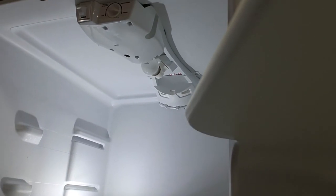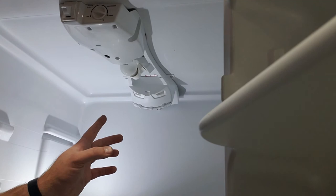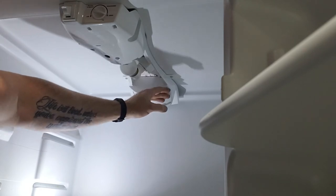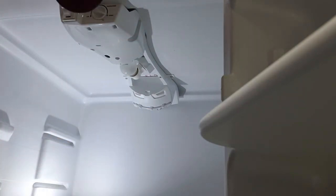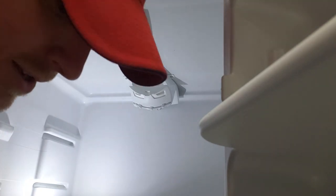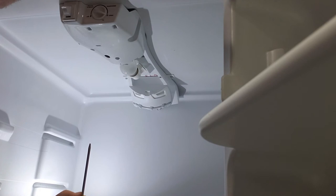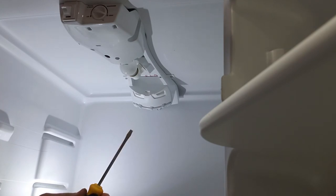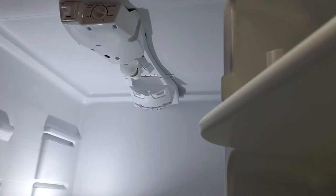So this other part can also be a problem. If you're having too much ice buildup inside the freezer, these are the vent holes that come down from the freezer. If you're not getting any airflow through there, you can pull down this whole assembly. One thing to show you — this fridge still has an old-style defrost timer that you can advance with a flat blade screwdriver.